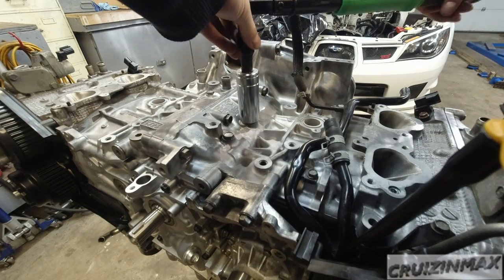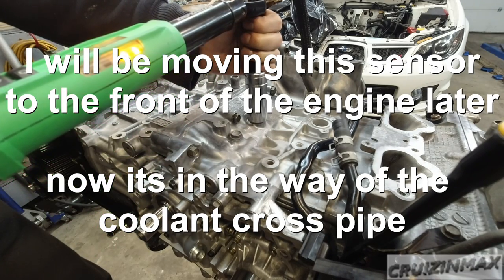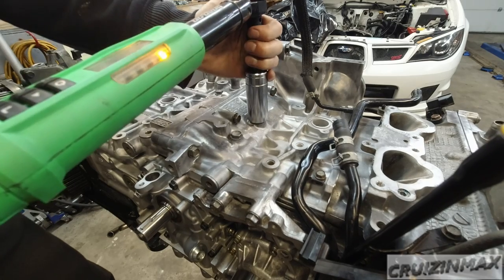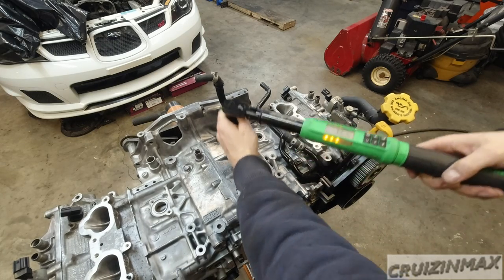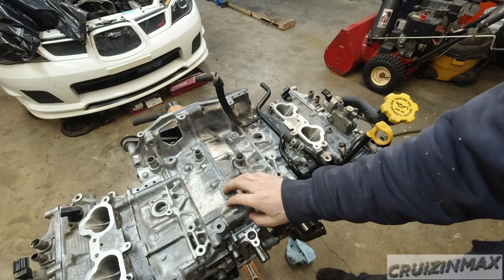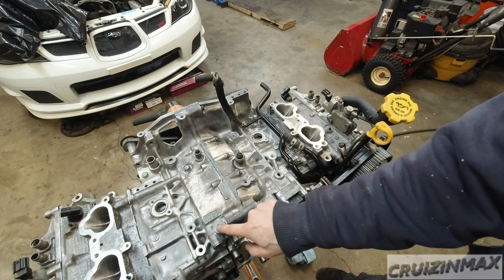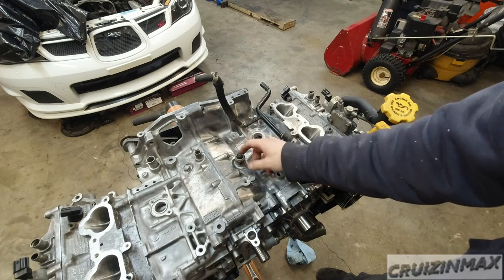The torque on the oil pressure switch — so many different names for the same thing — is 18.4. I'm going to do 19, but honestly 19 seems excessive. I found more info online asking for 17 foot-pounds; I'm at 14 to 15 right now. I think that's enough. On this 08 WRX block, the provision for the sensor has moved — it used to be in one spot and now it's in another. That's fine with me.